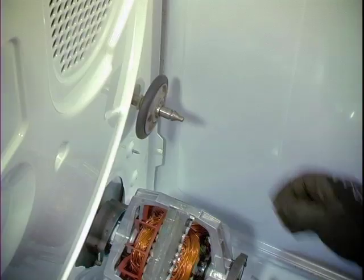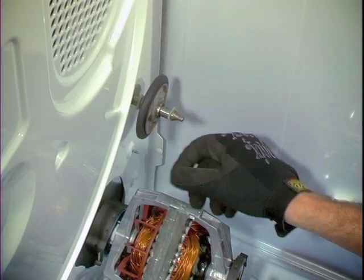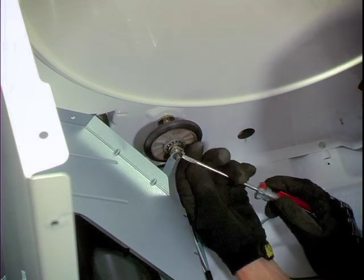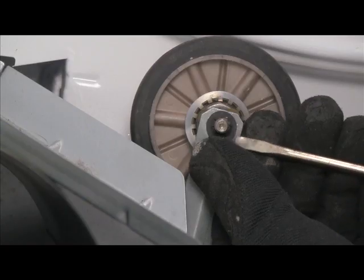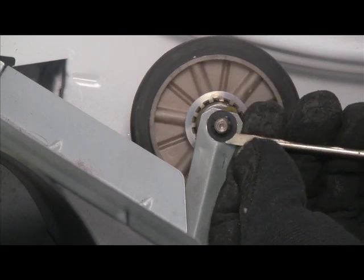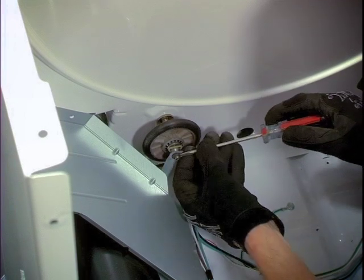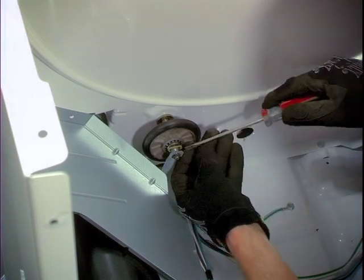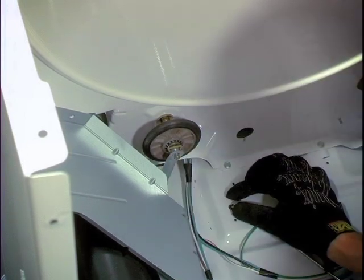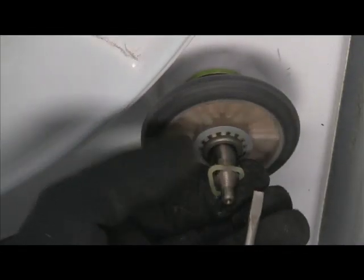Now back to the inside. The rollers are held in place by two plastic clips. The left side roller has a support bar held by a press-on clip that can be removed by working it side to side while applying pressure from behind with a flat head screwdriver. Try not to put it through your other hand in the process. Sometimes if you are careful not to bend these clips the triangle clips may be reused, but they usually require replacement after being removed.